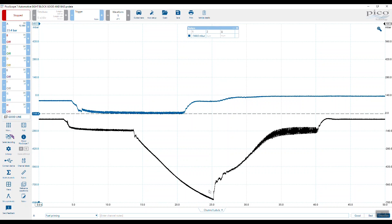Again, start the vehicle — here we are idling, we close the stop tap and look how this pressure dropped. Let's measure that pressure — peak negative pressure was negative 677 millibar. The system was sealed; this is the transfer pump now trying to pull diesel but prevented by the stop tap which we closed momentarily. Very soon, if we kept this tap closed, the vehicle would have stalled.